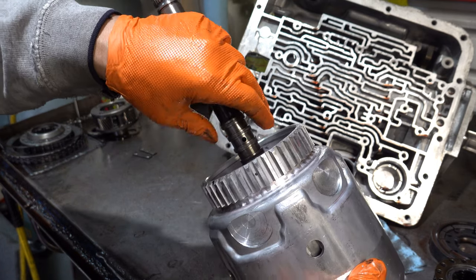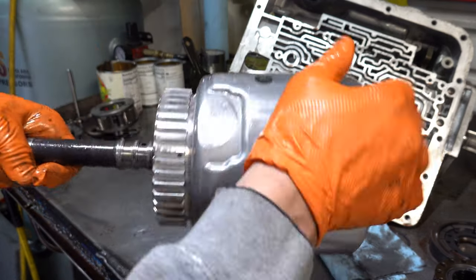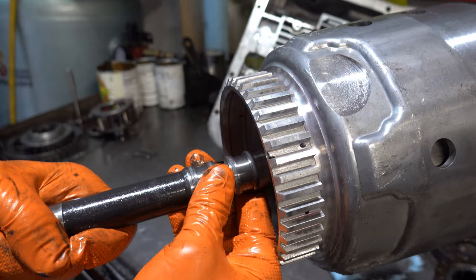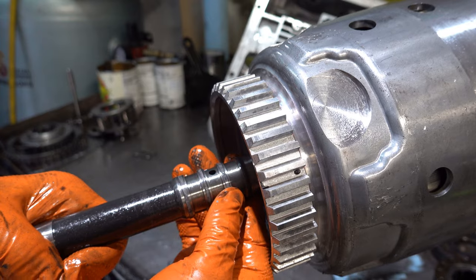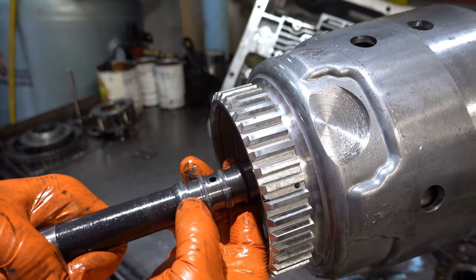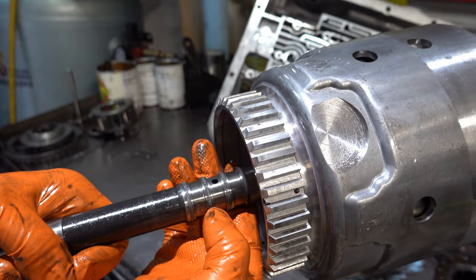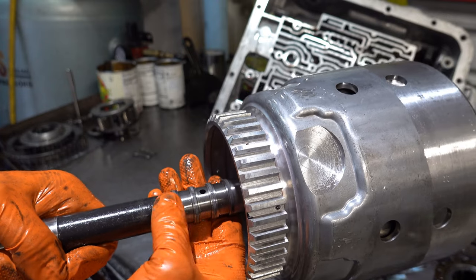This is gonna be your forward clutch feed. This is Coast clutch. So I don't know to what extent you could see these things, but if I get the camera to focus, what I'm looking for here are flat spots, lacerations, or anything else that would lead me to believe that this was the reason that clutch pack failed. I mean, I rarely ever see that. Or if I do, the ring is straight up cut in half or whatever.